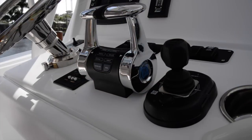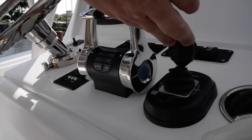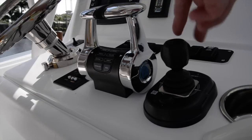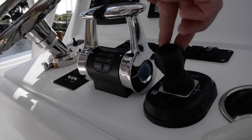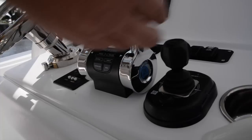Now, it isn't as quick as you might expect — you're used to pushing forward like a game controller on an Xbox, but it doesn't work that way. You've got to be more diligent and stay ahead of the boat. When you push it forward, do it a little ahead of time. Don't quickly slam it into reverse — let it come back to neutral, spool down, then pull it back. Be very gentle and deliberate, not forceful or aggressive with quick movements.